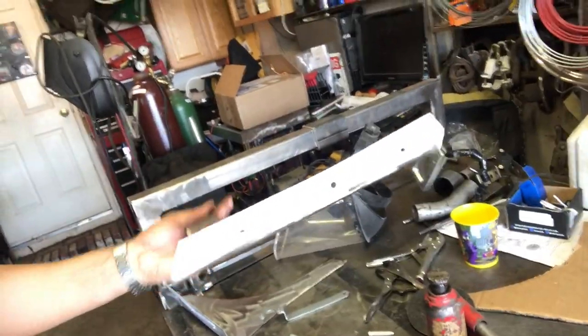Both sides are finally done. We're going to go ahead and get them pre-drilled — everything is already aligned and everything is actually perfect. Love the way it came out. We're going to get these things pre-drilled and do a small test before I get them painted or wrapped. We've got a couple small holes started and we're actually going to go a little bigger — I think we'll go 3/8ths — just so they're secured pretty good on the step lifts.